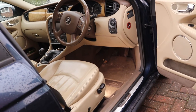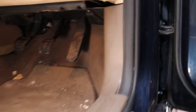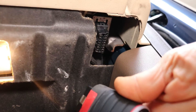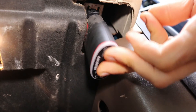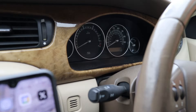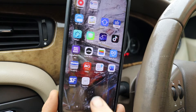First you need to look at the OBD port, which is down by the driver's side footwell. It's tucked away vertically and it's black in colour. Attach the device to that — make sure it's the right way round and it'll clip into place, then it'll light up green to show the device is active. Turn the ignition on and open the software on your phone.